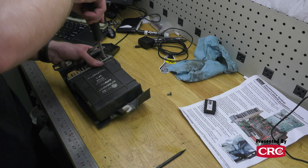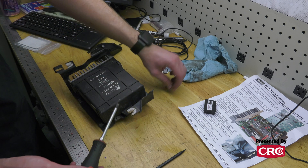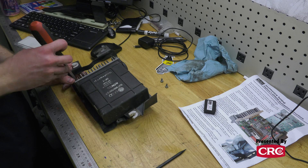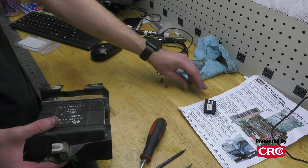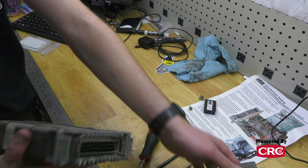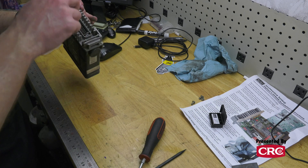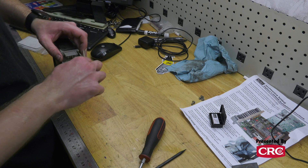A chip is basically the part of the engine control unit that actually has the tune — it tells the engine how much fuel and timing to run under each situation. On newer cars you'd just plug into the OBD-2 port and flash the ECU. On older cars like this, all that data is actually stored on this little EEPROM. So step one is to get into the ECU, which is just a couple of screws.